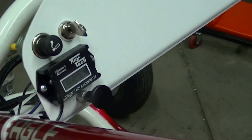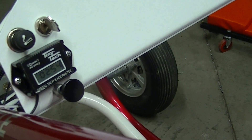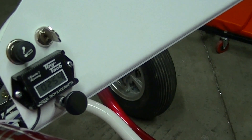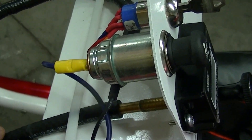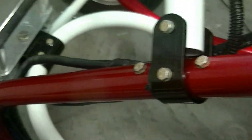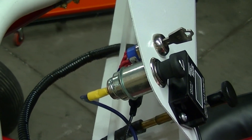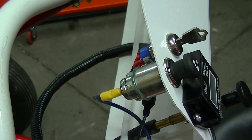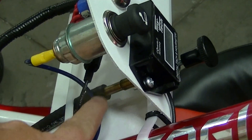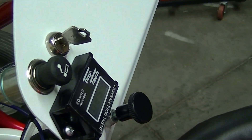The first thing I put on my dash was a choke cable. This choke cable is nine feet long — I bought it from NAPA for $14. I also bought nine feet of rubber hose because it's stiff enough to keep its form going around the frame, and it prevents the metal cable from banging around and scratching anything. I put a little grease inside so it slides nicely. To install, you drill a hole, slide the end of the cable through, and snug it up with the bolt.